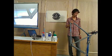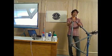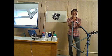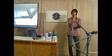So, part of the process, do you coat the inside of the frame for us too? Is that somebody else? No, that's somebody else's problem. There's this stuff called frame prep, and there's a number of ways to approach this. But basically, we plug it all off and put it in the stand just like that. We use mostly an aerosol. We'll turn it around just like he's describing and blow it with aerosol until the whole environment inside the tubes is soaked up with something really basic. It's usually not intense. A lot of times it's paraffin based.